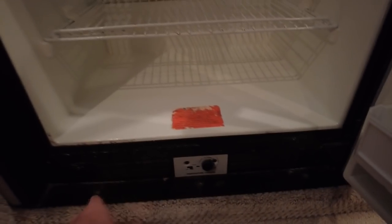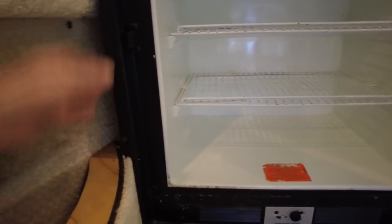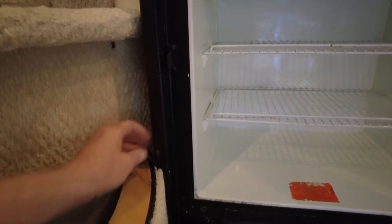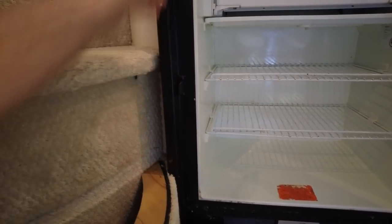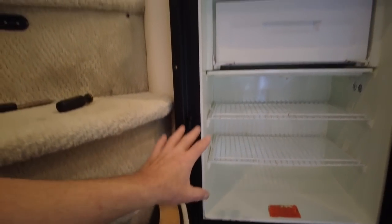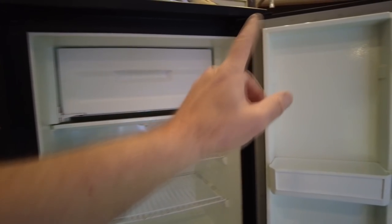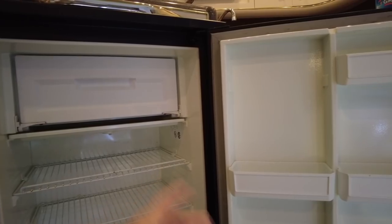All these screws are out of the frame, which is like a shroud, but it's jamming up against the stairs and there's not enough wiggle room to get it out. So I'm going to have to take this whole shroud right off the fridge itself, which is not a problem. To do that, I have to take the door off the hinge - which is going to be fine because I'm changing the swing of the door anyway.